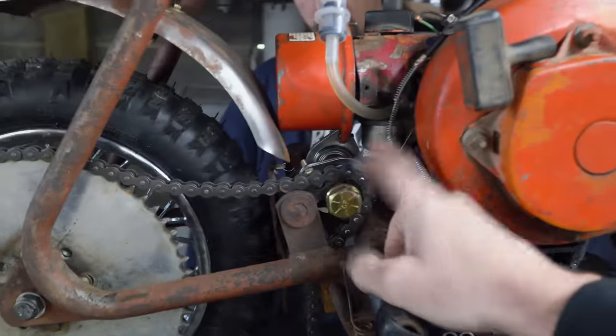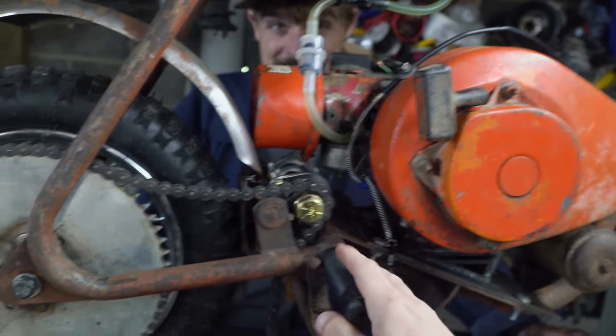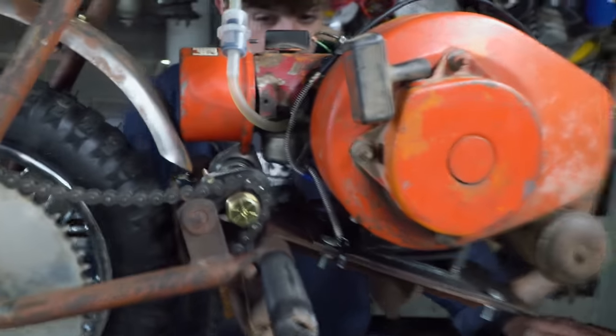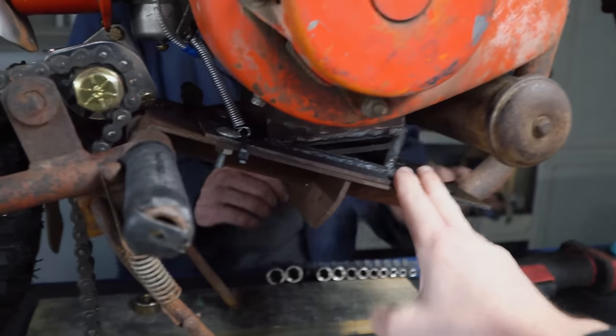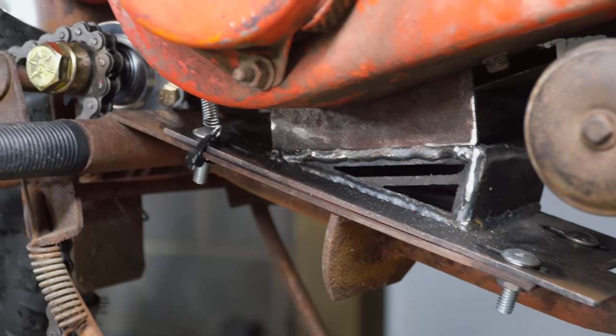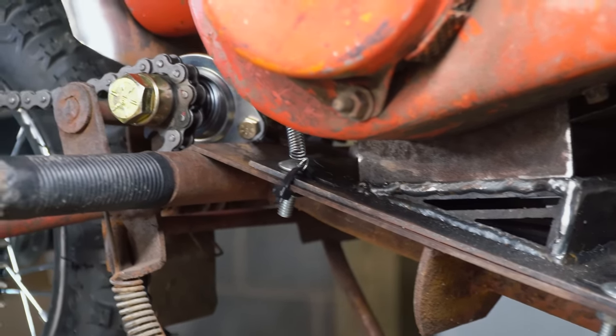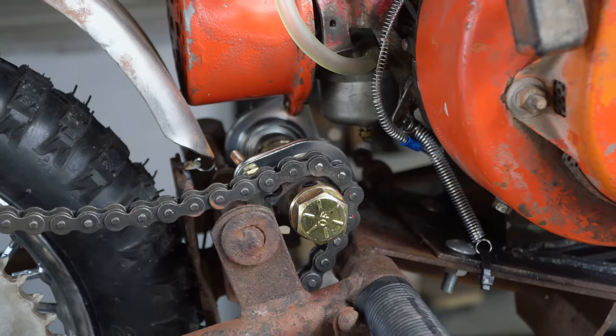There's no space. There's really not much space. So the jack shaft is mocked up and we're trying to figure out how we're going to mount it and also give us chain adjustability. So it's really tight in there, but it should be fine. So the idea is to cut basically a second engine plate that'll be sandwiched in between the factory frame here and the actual engine plate. And it'll run under here with slotted holes and be attached to our bearing hangers.